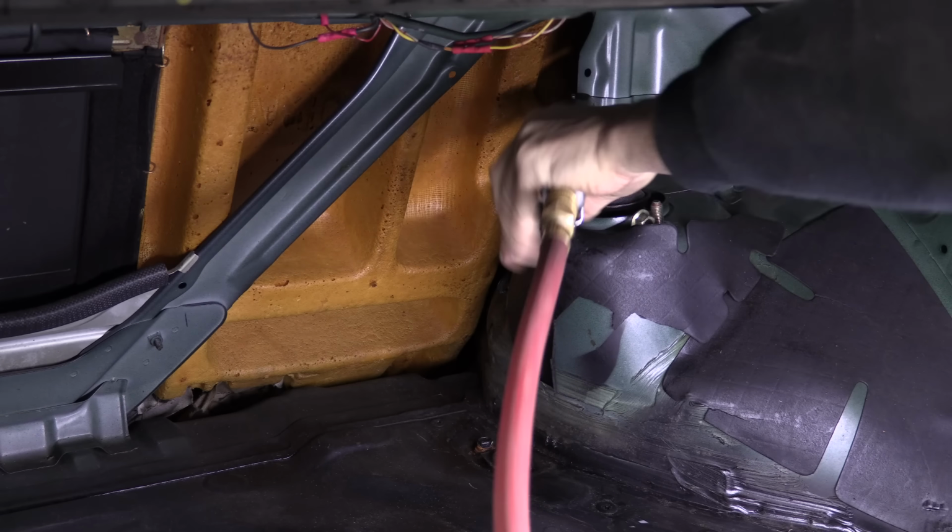Just like the speed sensor on a 2G or the sprag on a V8 distributor, the pump is driven by a ring gear on the differential, and that's the reason why the Galant's rear steering does nothing until the car is at speed. This is its power steering pump, and you need RPMs to make the fluid pressure. Of course, I didn't drain the rear diff, so for now, to me, this pump is just a glorified fill plug, and I need it if I'm going to go ahead and remove that rear diff housing now.